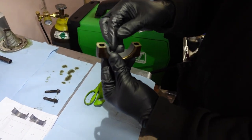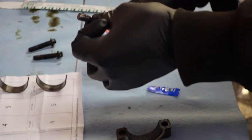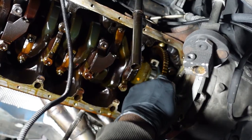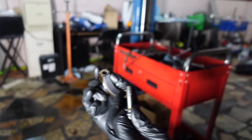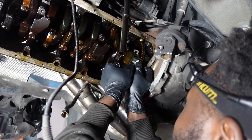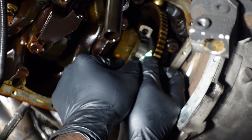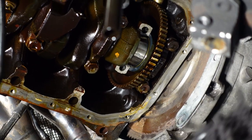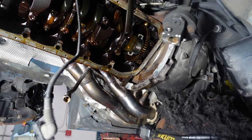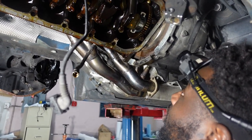We've got the plastic gauge on right now, and we're just gonna check the cylinder 6 clearance. How's that crank, B? So that's 0.002, in inches. We converted over. The clearance spec, I believe, is 0.03 to 0.07 millimeters, that's 0.001 to 0.003 inches. Anywhere in between there is acceptable clearance.